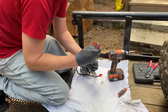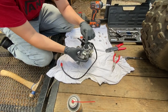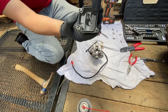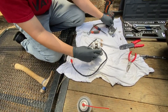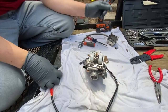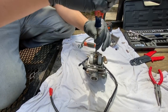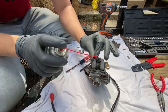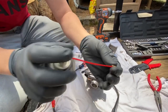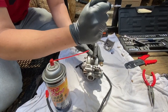This is what's coming out of the carburetor, so now we're gonna clean this entire thing out. I'm gonna reinstall this drain screw. Once you have the bolts taken off the bottom of the carburetor — this is the top, this is the bottom — you're gonna want to pull that off. You can already see in this carburetor: it's brand new, but there was rust in the gas tank so it got a whole bunch of dirt and debris all over in there. We're gonna pull out the main jet first. I'm just gonna spray a little bit of carb cleaner through it — this hose fits right in there and you can spray it right through. That one's good, set it to the side.